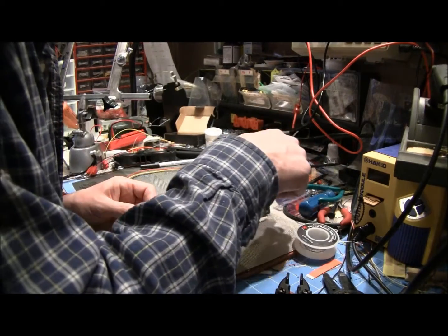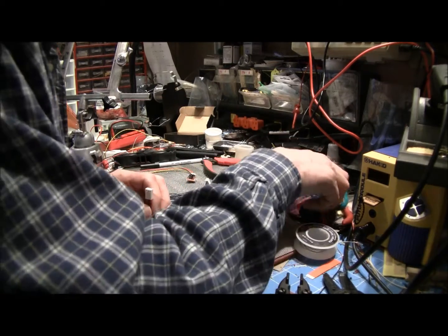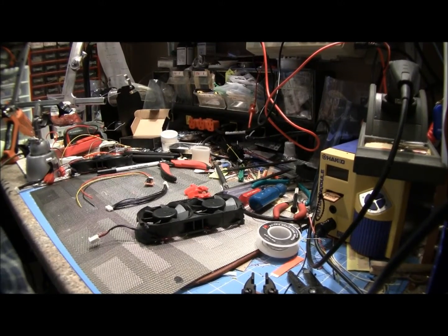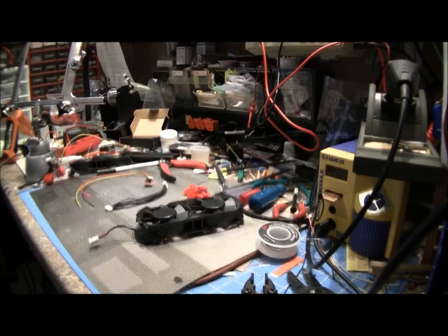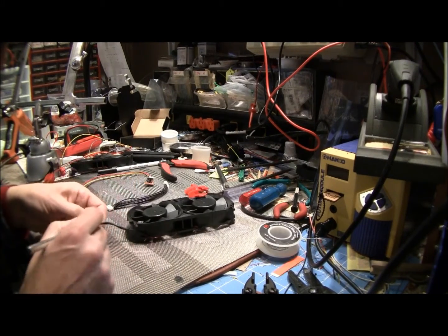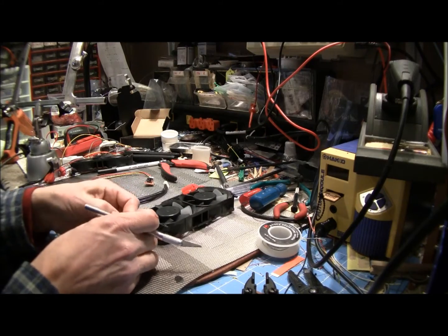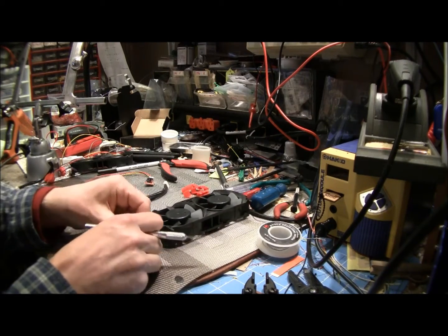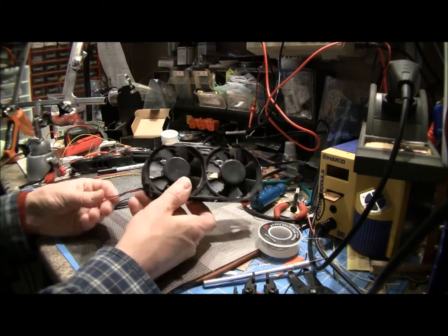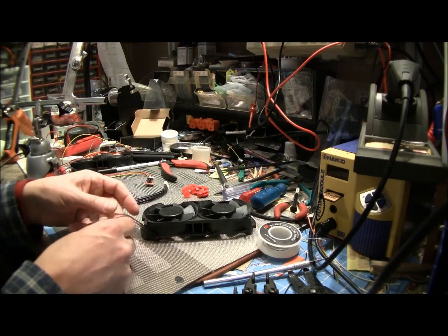So if we're doing this, we're going to take a knife. Your 3-pin connector is going to need to be cut apart, so we're going to use a knife to cut that up. We're going to take our wires here and cut back our insulation. It shouldn't be this hard. Once you make a slit in it, you can just peel it off and then cut the remaining off, so we want to expose our wires. Now again, our blue and black are our grounds, so they're going to the center pin, and then our GPU is the red and our CPU is the brown.